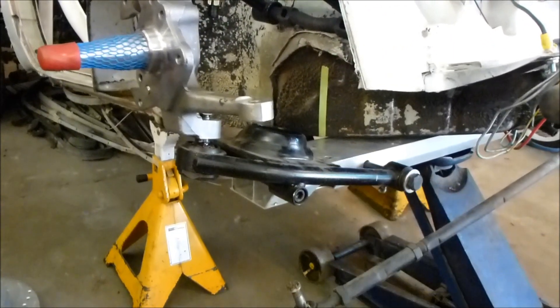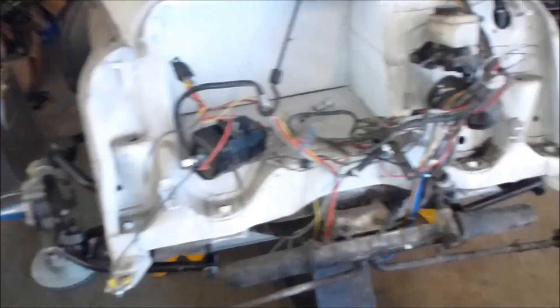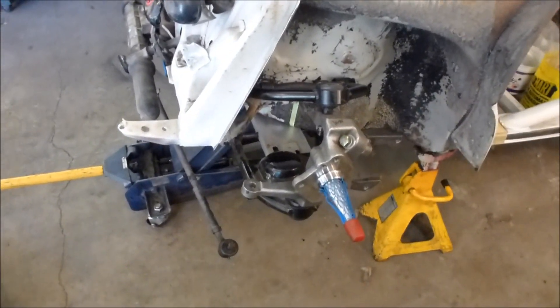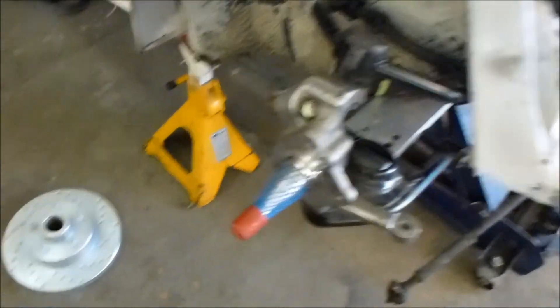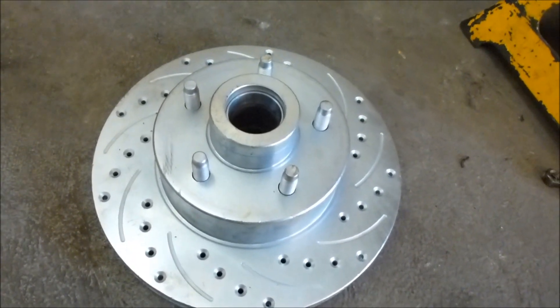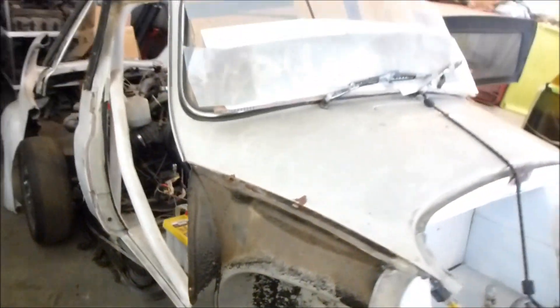It's not going to look this high — I've just got it set up there for now. I've got to do some coil overs and stuff, but I'm getting pretty excited because I might be driving this car again soon. It's been a lot of work — nothing fits on these Subarus. There's my factory rack and pinion, and there is my theoretical design of my new front suspension. I'm going to run these big old heavy hubs and discs — 14 inch drilled and slotted — because the last time I drove this car it couldn't stop, and it was really scary.